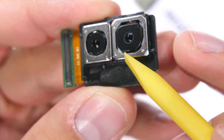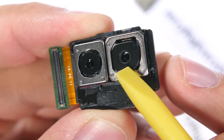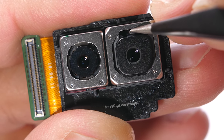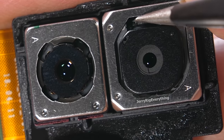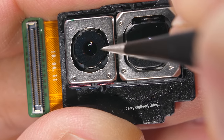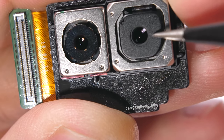But once it's off, each lens does indeed have its own hardware stabilizing built in. The 12 megapixel variable aperture camera, which you can see opening and closing here, has a physical aperture mechanism which changes automatically to let in more or less light as the camera needs it — and it's also hardware stabilized. The 2x telephoto zoom lens camera on the left is also optically stabilized. This is probably the most high-tech, complex system of cameras in any smartphone on the market right now.